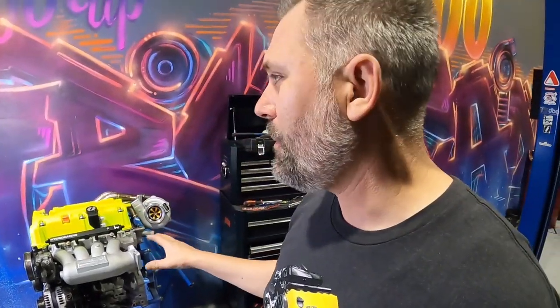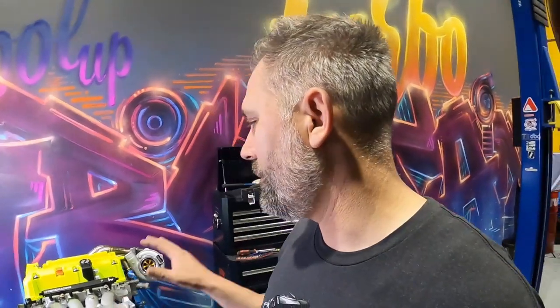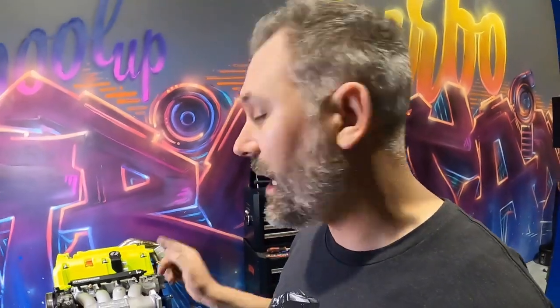I'm really happy with it. It's the look and style and everything that I want to go for. I'm not going for gigantic power on this, probably around 400, 450 horsepower, maybe push it to 500, maybe, but I'm considering keeping the rods and pistons stock in this. Still undecided if my budget will allow me to do valve springs and retainers and the K20 oil pump. I know those are both really smart ideas and I know I should do them. We'll see if I can find a deal on those.